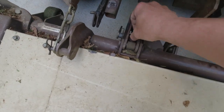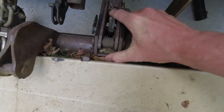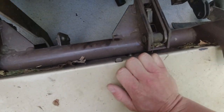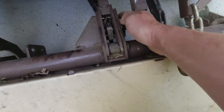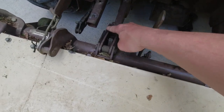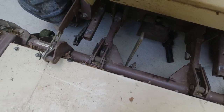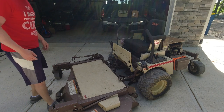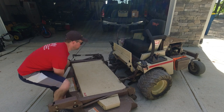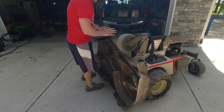All we have to do is release these catches in here and then pick it up. On each side we've got this little catch. You can see this little notch — you're going to bring it forward and get that spring to set in there. Grab the outside pin and roll it forward. Now at this point it is ready to go. This whole mechanism is going to pivot on this pin on both sides. If you're a little concerned about the weight, you could always have a friend help you. You get underneath it with your hands and then you lift — and it's up.